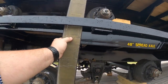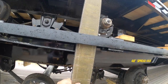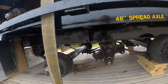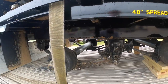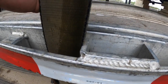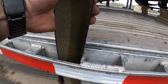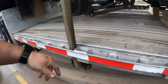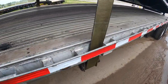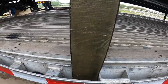There's a lot of stress marks here on this strap. Plus, you got something stacked this high, you want this strap to have a twist in it — twist away from the truck. That's why I usually do it that way: when the wind comes, it'll slide right over the strap and it won't sit here and flap in the wind. They've got this right next to this sharp stake pocket here — that strap's right next to the sharp stake pocket. So as you're driving... Let's go to this other one. That one is super tight — I mean, you can play banjo with that. You can hear it rubbing right there, so that's going to be an issue.